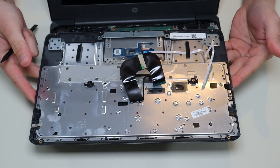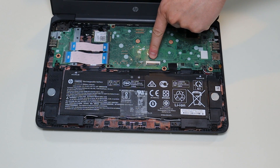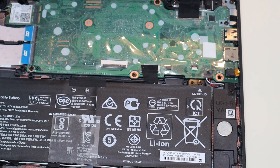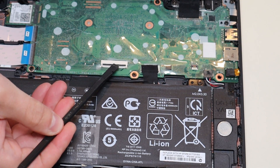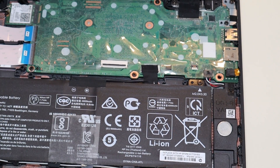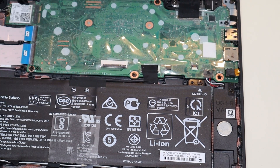So that's how you would get your palm rest off. The large ribbon cable from the keyboard went here, the small ribbon cable from the touchpad went there. The clips are very fragile — if one breaks, you most likely won't be able to find a replacement and your ribbon cable won't ever be secure again. The way to do it: slide it under the black clip and that pops it up. It opens almost like a book cover. After I unplug it, I like putting it back down just for safety so it doesn't get caught on anything.